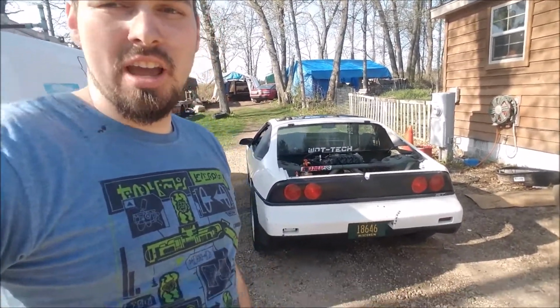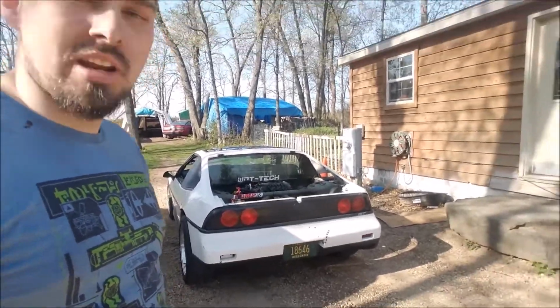It feels good. It's got some cojones. Unfortunately, I'm gonna be running 7 pounds of boost for a while, because I'm not gonna mess around with any more of this until I can get a MicroSquirt in here, because Ben says this sucks to tune, so we're not even gonna try and go bigger. That was supposed to be a 10 psi spring, but it wasn't. I could have thrown the 4 psi in there with that 7, and I would have had like 11, or probably 10, because these springs are weird. But yeah, that'd probably be my only complaint for eBay wastegates.